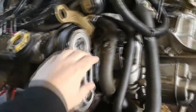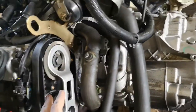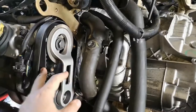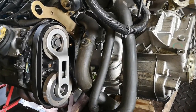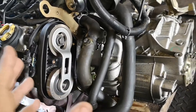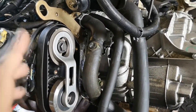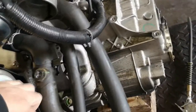That's why I always recommend people to use timing belt tools, because marking it up just doesn't cut it. You're always going to have a bit of variability in belts due to how stretchy they are and how tight they are. Marking it up - I get the principle - but it doesn't give you the exact timing.